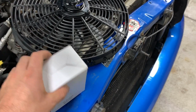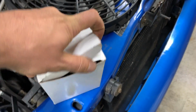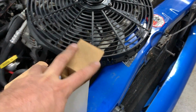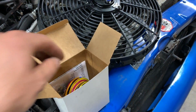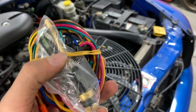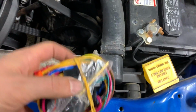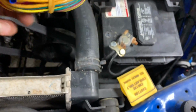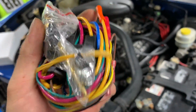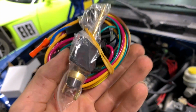And to control all this, we bought a Hayden controller. I'll link it in the description below for you guys. This was the easiest kit that I found. A lot of different ones want you to tap into the coolant hose, but I didn't really want to do all that. This one has everything, and see this long probe here? You slide it in and through the rad, and it's supposed to pick up the temperature of the rad from that probe. I'm kind of looking forward to that. Hopefully it all works. It's got the relay, it's got your fuses for a 2-speed fan, all that good stuff is in there. So let's get to it.